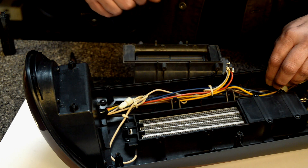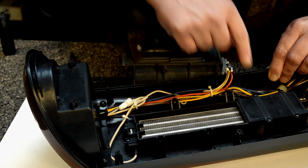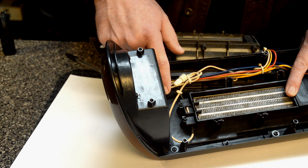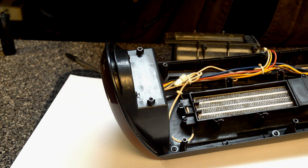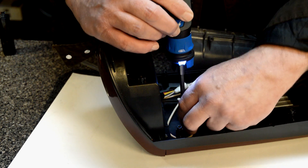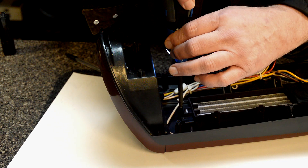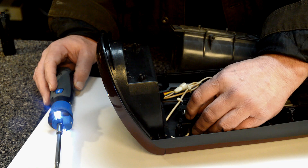And if you want to do this whole bar, you can actually take these four screws off here and clean under here. Now, up here I want to draw your attention to this thing right here — this is a thermal cutoff unit. And if these contacts in here get dusty or dirty, it doesn't work well. This may be bad. You could actually pop this off there — let me show you what it's all about. You can tell because there's two wires going to it, and then on this side there's three for the coil. This is a plastic cover.